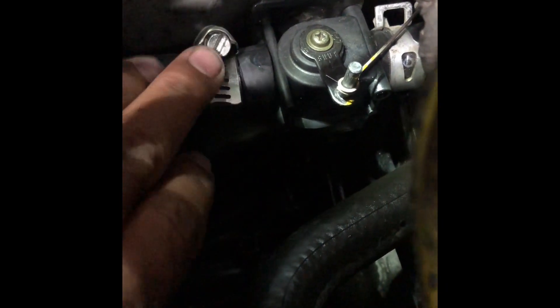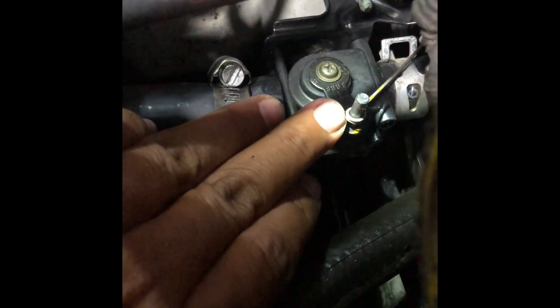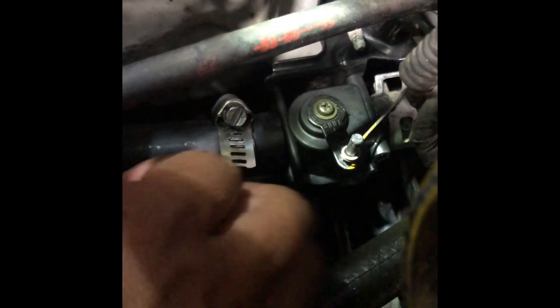Just remove this right here and yank it. Remove the hose right here, remove that nut right here that's holding it, and disconnect this one right here. Lift it up — there's a clamp in there — lift it up, and then remove that clamp right there.